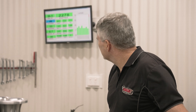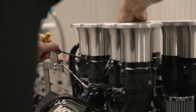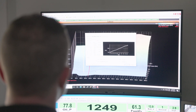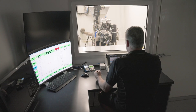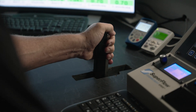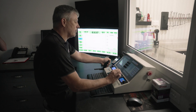For people that haven't seen an engine dyno before - give us a rundown of how the setup works compared to a chassis dyno. The room is soundproofed as best you can have it. You've got the ECU and dyno software with two lots of information. It basically runs off a water brake and you can do all your full throttle runs and part throttle runs. You can't do decel and stuff on there, but you leave that for the car. You can pretty much get the engine within 90% of where it needs to be.